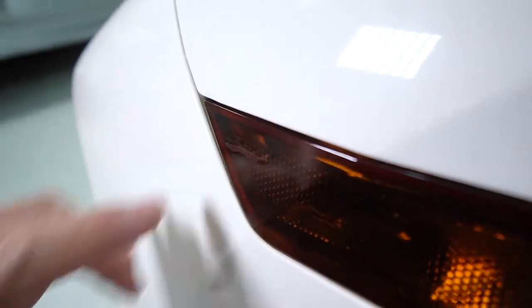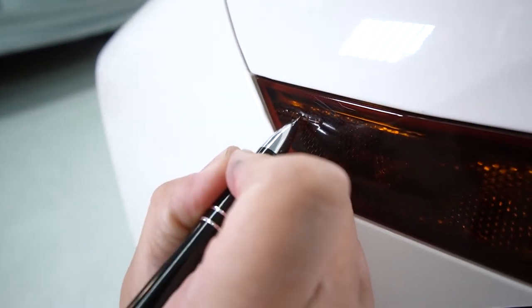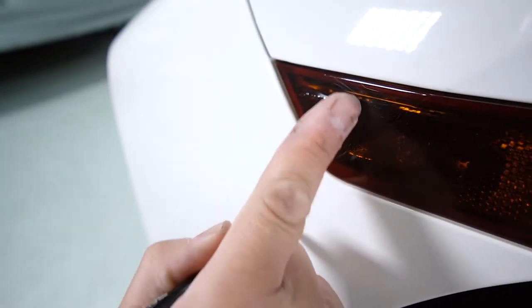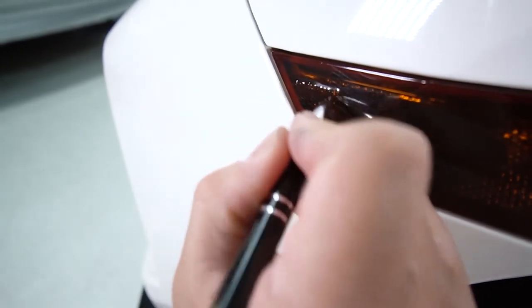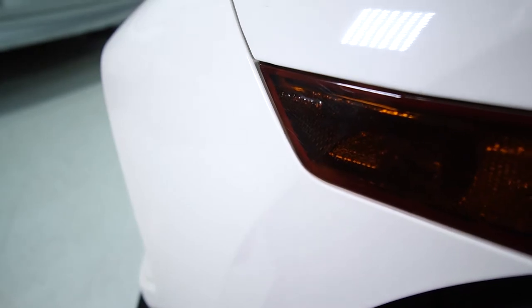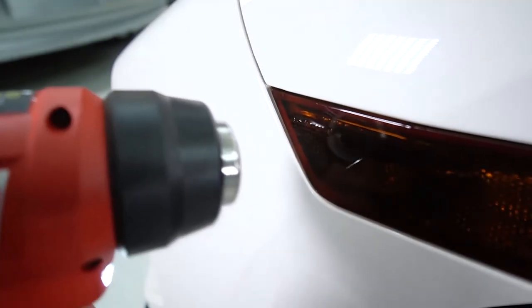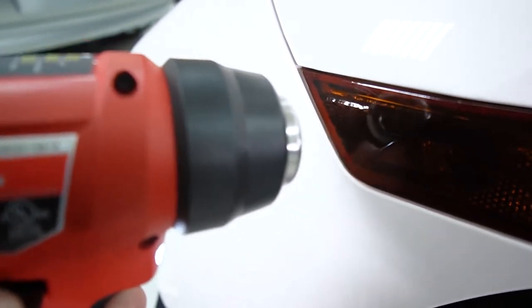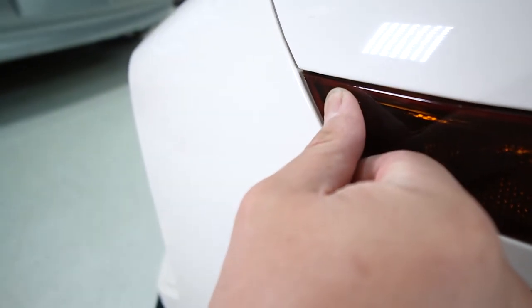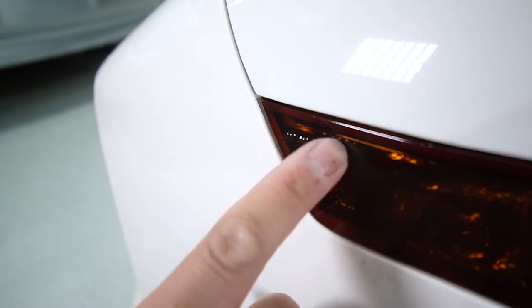The bubble from the imprint lettering of the side marker — all you have to do is take a threading needle, poke a bunch of holes right where the lettering is, then take a heat gun and wave it over that area. You don't want to concentrate on one spot, just move it around and get some heat going. You'll see the vinyl loosen up, then press down and it molds to the lettering.